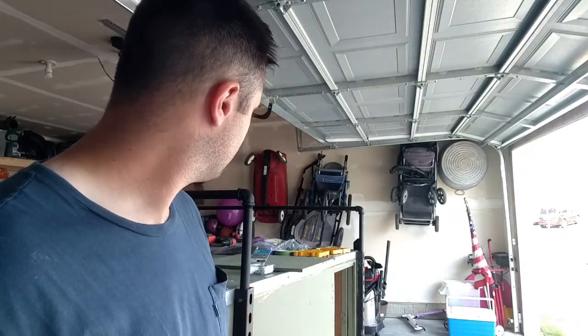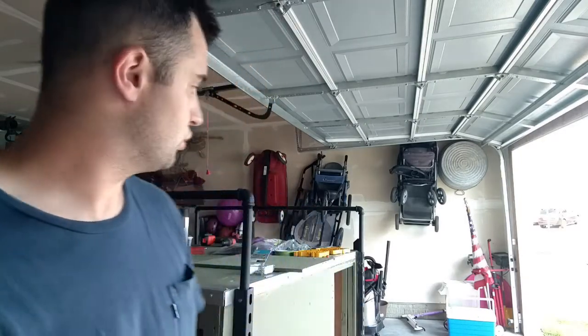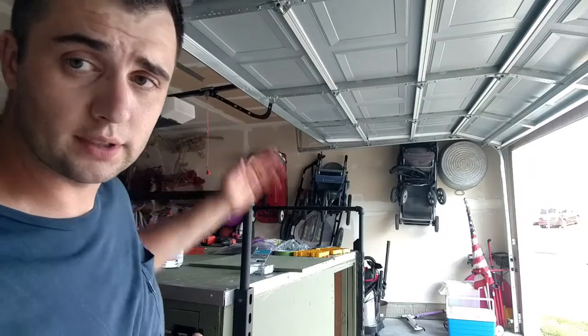But last night, what I did was I took the platform that I have for the sleeping platform, because it's going to be hinged, it's going to open up kind of like a clam. I got the bottom one done, the main one. I attached it to the aluminum rails that are going to run across here. Everything's all bolted up. I just have to take off some of the excess of the thread on the bolts. And I just need to assemble it, put it back on there. I'll do the same thing for the top part. I'll rehinge it and repaint it, reseal. I got some weather stripping to go in between so it keeps it kind of watertight.